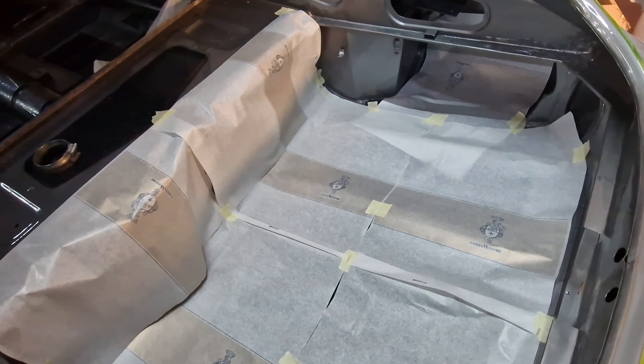This is the result of the anti-corrosion treatment in the hollow chambers where we've been in with the nozzle and hose. It's all in here — we used about one and a half kilos. You can see that in these holes it's completely inside the bulkhead, in every hole and every corner. That is a nasty job. Expect some will run out when the car is in the heat, but that is how it is.